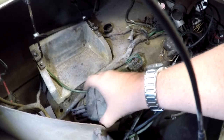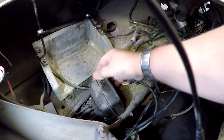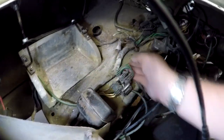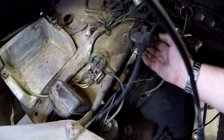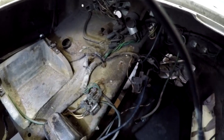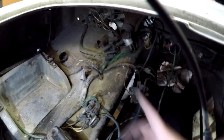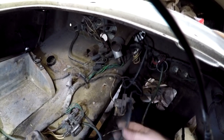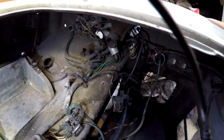So we've got off the main — that's either a voltage regulator or a fuse box, one of the two — so we've got this little auxiliary fuse box off there, we've got the coil or condenser off, and we've got a solenoid off there. All we've got to do now is get in here in this area and try and disconnect the cables at the back there. I want to take a picture of all this lot as well in there, just to make sure that we know where things go back, even though we've got a wiring diagram probably. So I'll get the boys to lift the car up and get me inside, and then we'll take it from there.